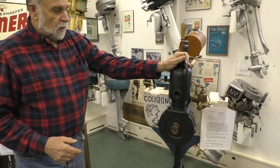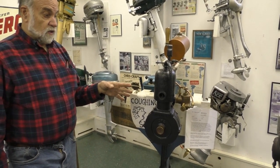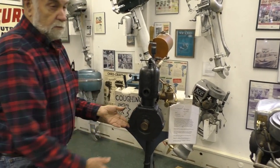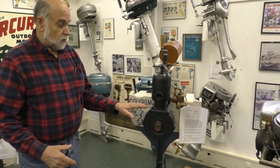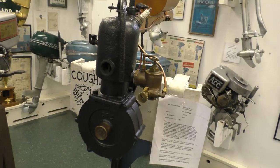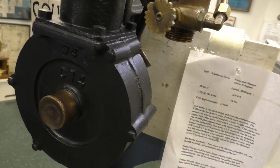He really came up with a design which was quite a breakthrough at its time. You can really see the motorcycle style in the crankcase. The flywheels are part of the crankshaft and are enclosed in the case — that was typical with motorcycles from almost day one. We're looking at the flywheel and the crankshaft in this case, unlike the inboard over here where the flywheel is external.